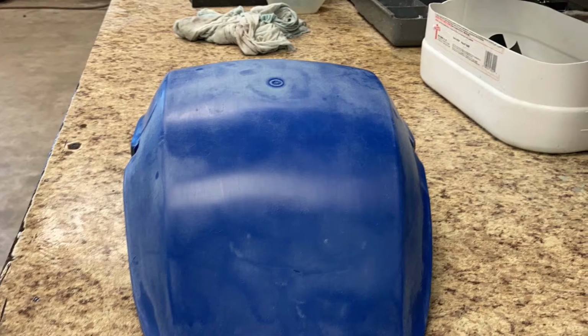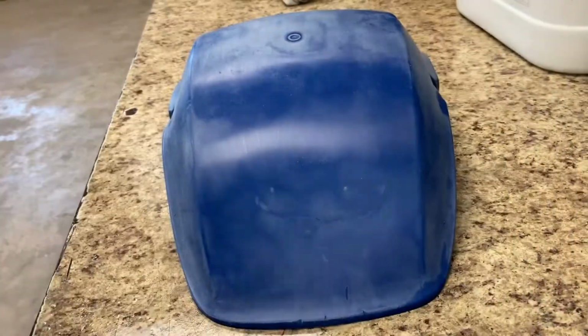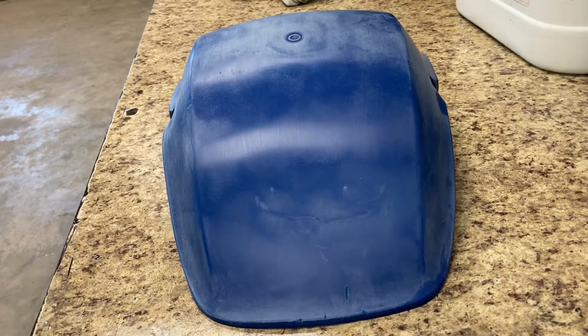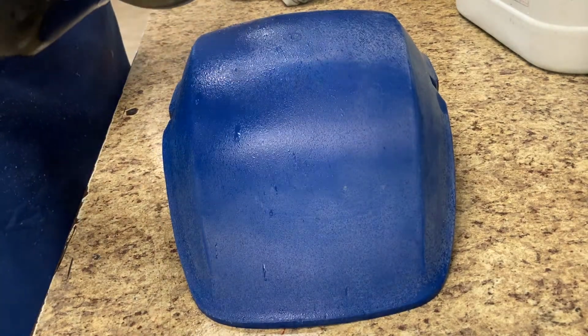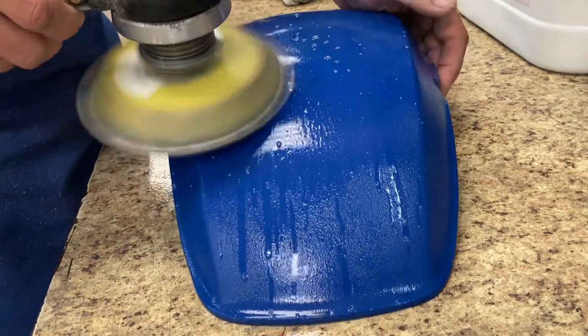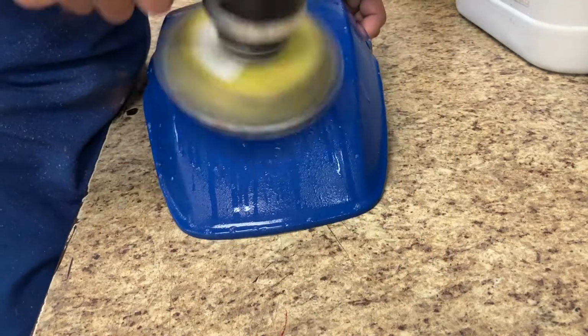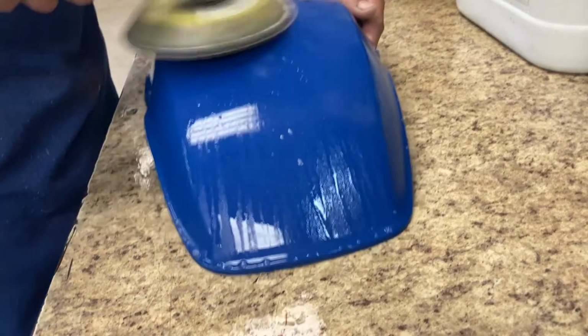They work a whole lot better than normal sandpaper, but they don't cut a lot. So it's basically, you're almost getting to the pre-polish stage at this point with the 3000. After this, I'll move to the 5000. I'll dry, kind of bounce back in between with a little sandpaper by hand to touch some spots that didn't look right, and going to buffing after that.